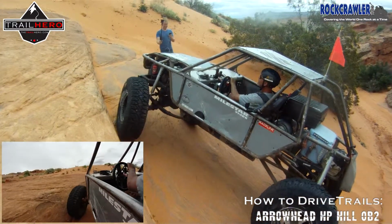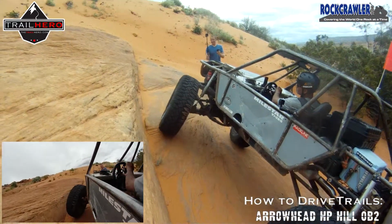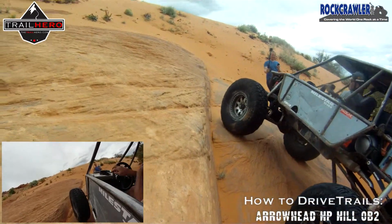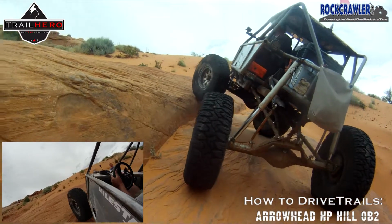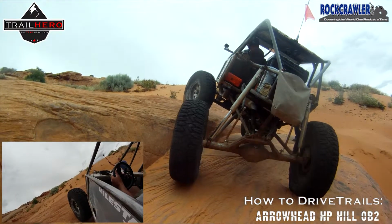Now he'll disengage the rear locker and pull the driver's rear cutting brake to force the front to climb the wall on the left. The rear hasn't disengaged yet, which is why you hear the brakes squealing and the front pushing rather than climbing.